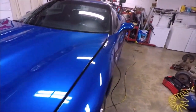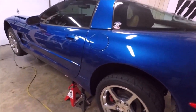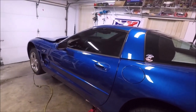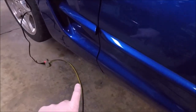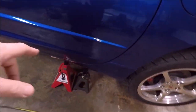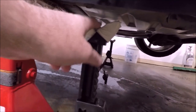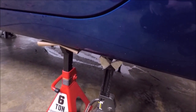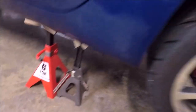I'll also usually put jack stands in a similar place on the rear cradle, but obviously we can't do that because the rear cradle is coming out. Once we drop the rear end and cradle, the car is going to get kind of front-heavy, so I wanted the jack stands far forward — that's why we put the front ones all the way up near the front so the car doesn't want to fall off the stands in the back. We used our six-ton jack stands on the factory jacking point.